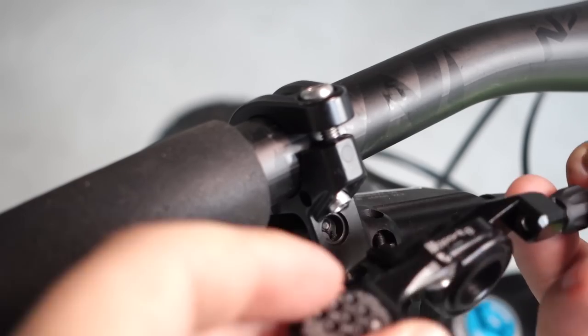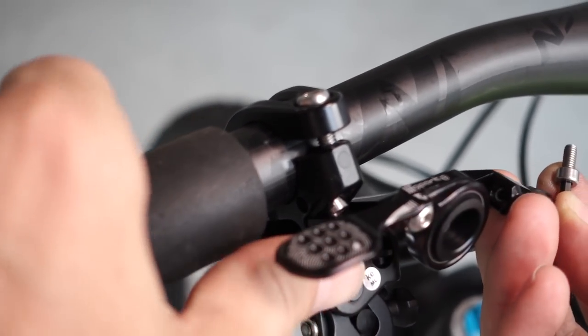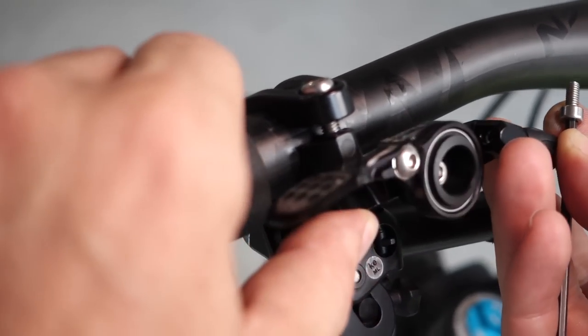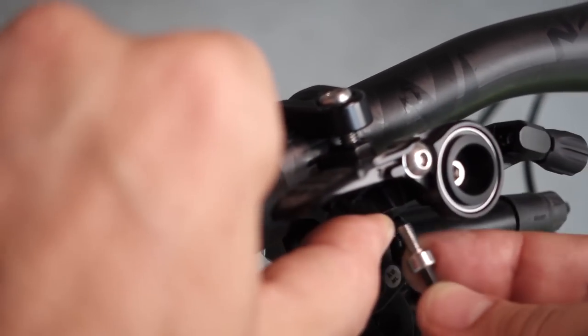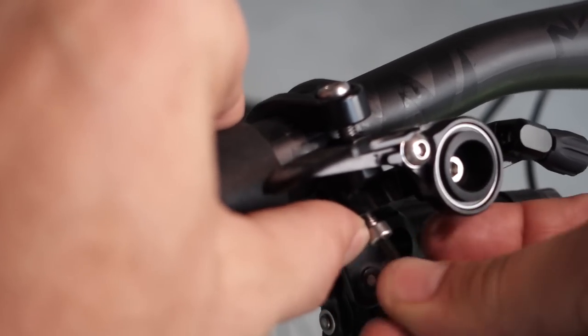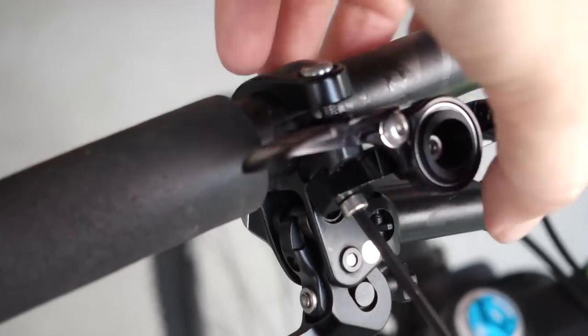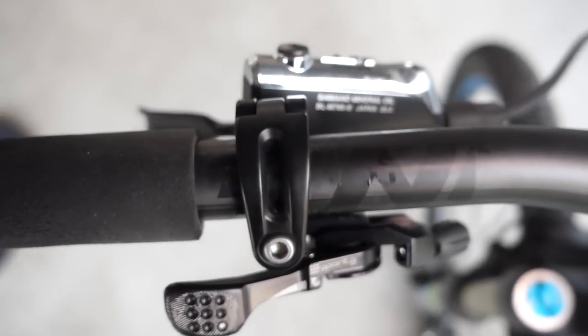What I actually did here is over-rotated my brake onto the bar just so you can see how it attaches. So that's my iSpec B attachment - this is the attachment point. It's going to snap into place. And this is my 3mm screw - put a bit of Loctite on that one like I said. So here it is installed, and it's actually very similar to my shifter on the other side. Ergonomics should be okay.